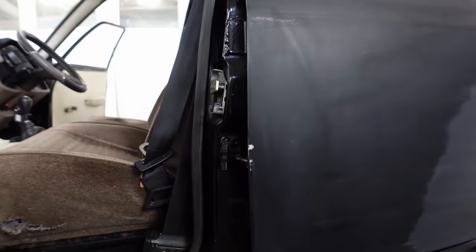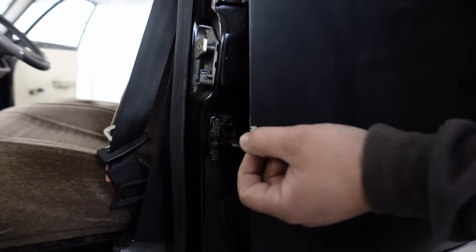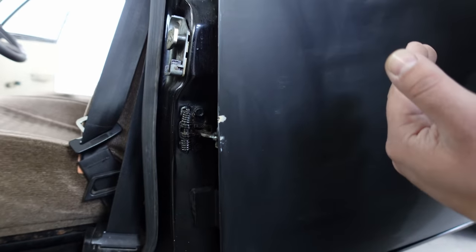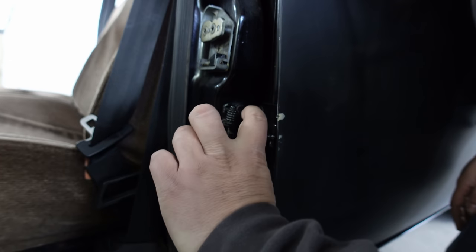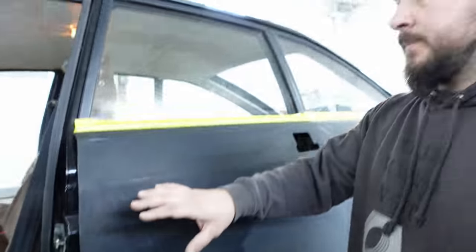So that's what's going on. If we paint it, it's just going to knock the paint off. If we put filler in it, it's just going to knock the filler off. So I checked on the other side, and this whole mechanism is around the other way, so the spring is further inside, which makes total sense to me. So I think somebody has either bought the wrong hand side part and put it on there, or they've disassembled that and reassembled it incorrectly.